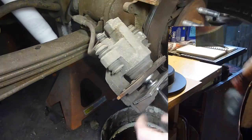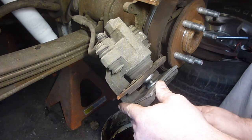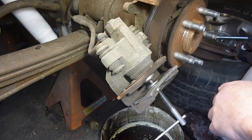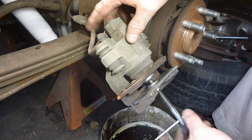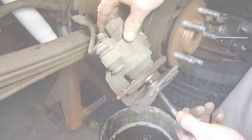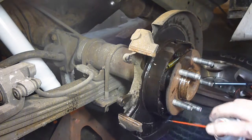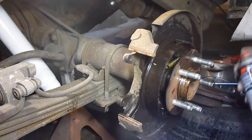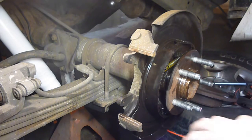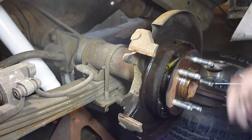Holes to holes — there's one here, set in between here and the brake pad. You slowly — very slowly — push it in. If you do it too fast, a couple things can happen: you can shoot your brake fluid right out the bottle up front, and you can introduce air in here. I've got a bucket down below, and I'm just going to take my brake cleaner and spray the ever-loving bejesus out of it. You can choose how far you want to go as far as cleanliness and cleaning. I'm okay with just hosing that down and being good.